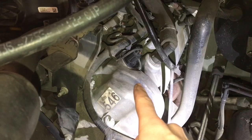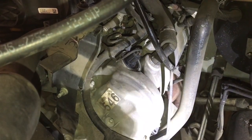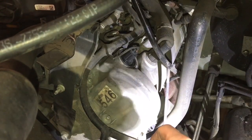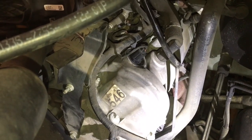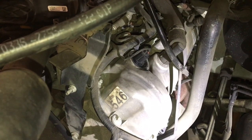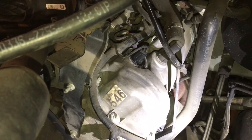The first thing we want to make sure of is that this solenoid is not stuck open or closed, causing this timing issue. It should be closed at idle. So I'm going to start the truck up, unplug that solenoid connector, and make sure it's not partially stuck or stuck open. We'll see if there's an idle change or if it fixes the roughness.